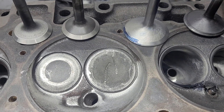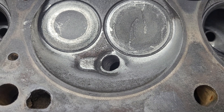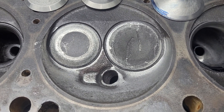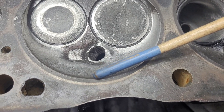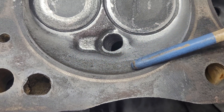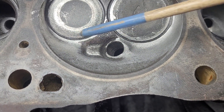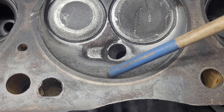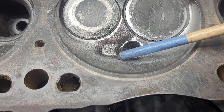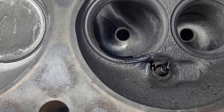Let me think for a second and see if we've got anything else to talk about. I started working on the chamber but I realized it's really difficult to follow DV's cylinder head chunk because it's been milled down so much — literally this entire ridge here, which is probably over a hundred thousandths deep, is completely gone on his, and a lot of this pad has been changed. He did a ton of work in there — he wants to get airflow through here to evacuate that area. I can show his chunk because he's already had it on his videos.